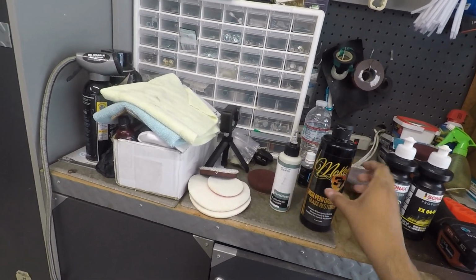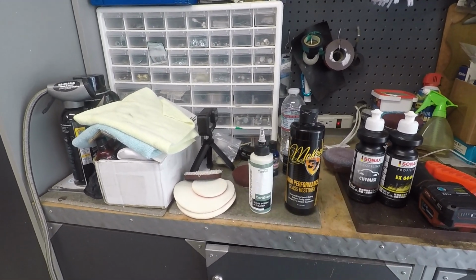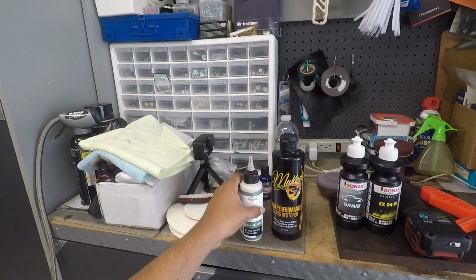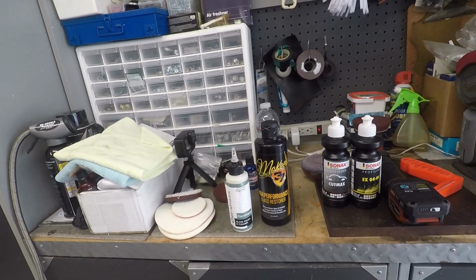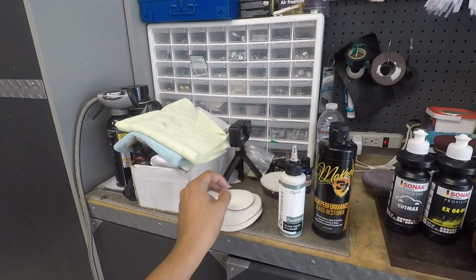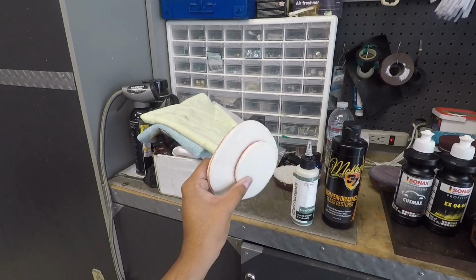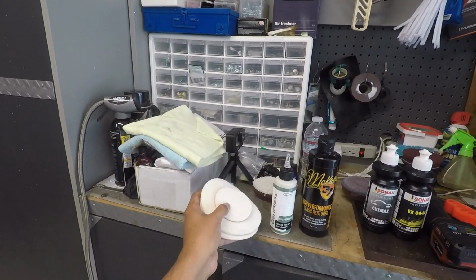Again, we have multiple versions here. You have the old staple, which is Carpro Ceriglass, which has cerium oxide. Now this is actually going to remove wiper blade scratches, but it's going to take a lot of work. And in terms of pads, just get the Carpro glass pads. That's what they're designed for. They're really thin rayon pads. These are meant to be used with that product.